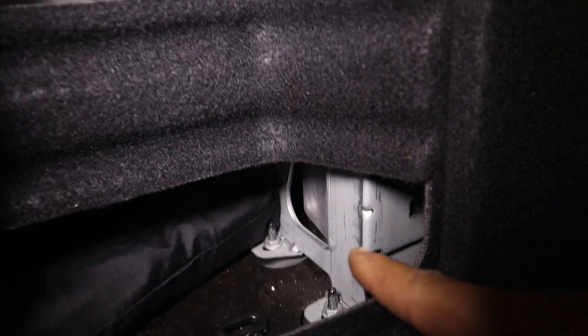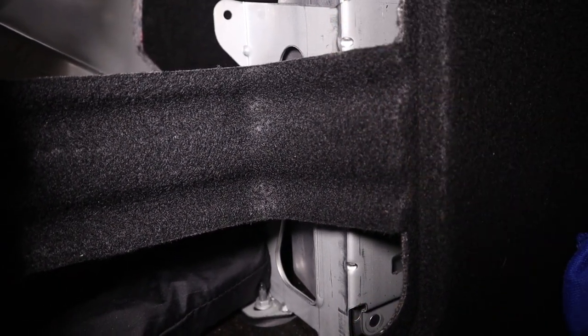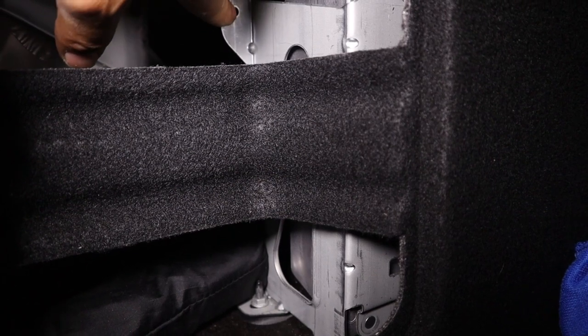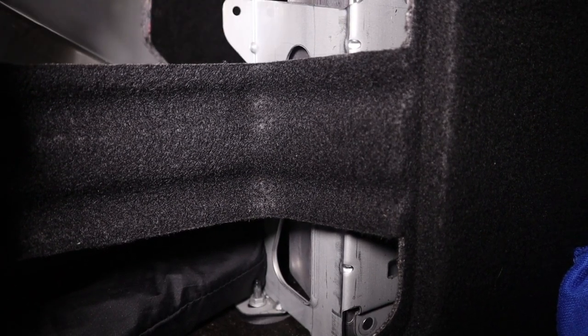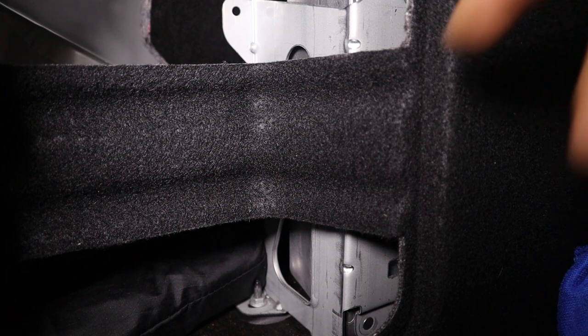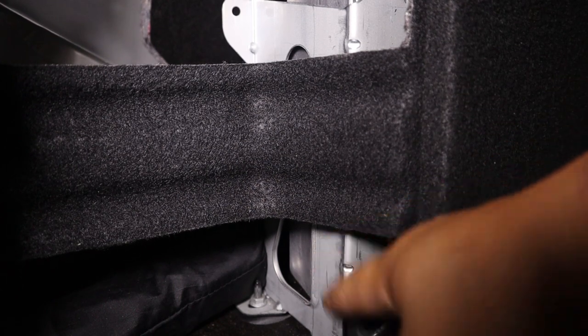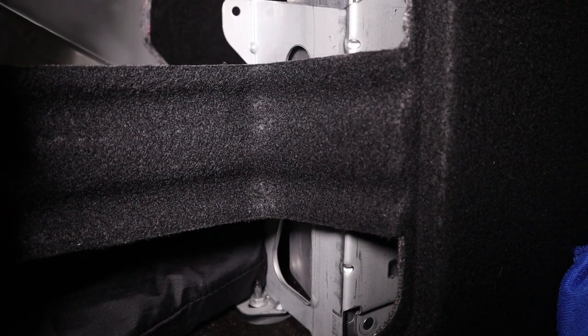You can use either one of these bolts, and because it is connected to this metal plate that holds your amplifier, I'm also sure you could even put a bolt through here, a nut on the end, and then simply bolt it down, and that can be your second grounding point for your left hand side. So you could use for the left hand side either these two bolts down here, or just simply put a bolt through there and a nut on the other side, and it would work also. And these are the grounding points you can use.